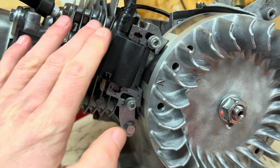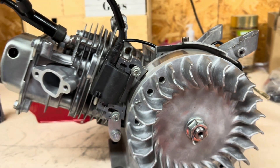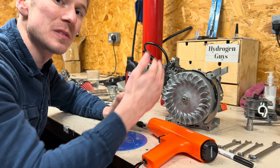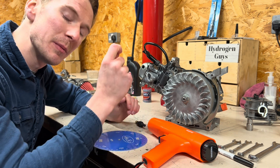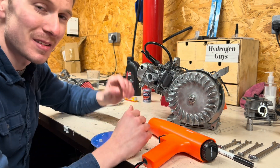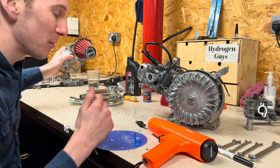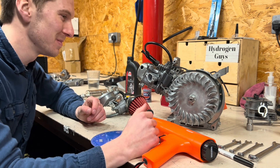Right now this engine is set to around three degrees after top dead centre. That is pretty much it for ignition timing on a hydrogen engine — set to top dead centre or slightly after if you want to be extra safe. It's very simple to do but it's one of the most important parts of your hydrogen engine build, because if you don't do it you'll knacker your engine. Next time we'll be finishing the engine off and giving it our first test run. All we need to do is add the oil, add the hydrogen carburettor back on, and we're good to go. See you next time!